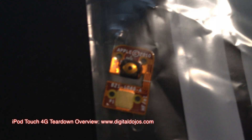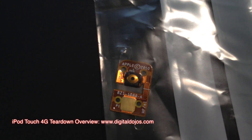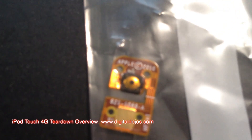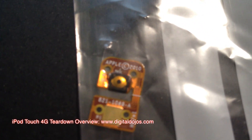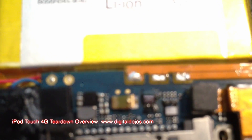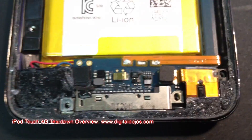If you ever have issues when pushing your home button and it's jammed — basically the home button, which is this thing right here, pushes down on that little black knob right there. That knob pushes down and hits that gold contact right there. That's basically how your home button works.